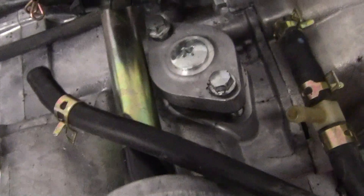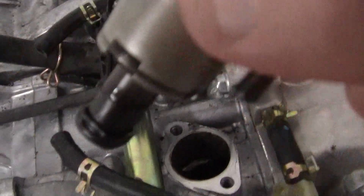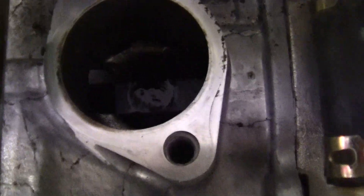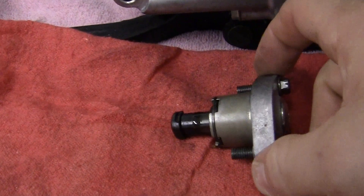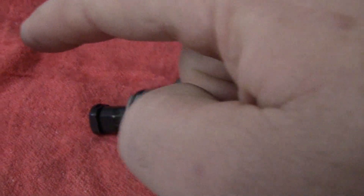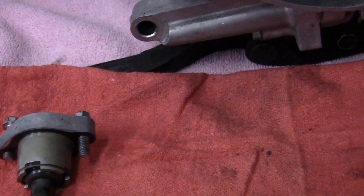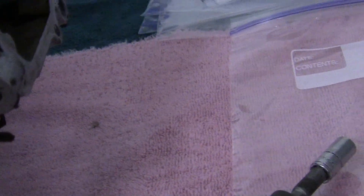This little Makita torque driver works great. Now you can see how that's just popped out there. You can see the belt — it's right underneath this rubber pad here. And here's your cam chain tensioner right here. This bolt controls how far the cam chain tensioner goes up or down. We want to put that aside onto a clean rag, before I clean it and put it into my neat little bags.